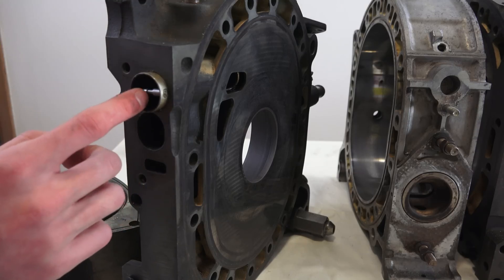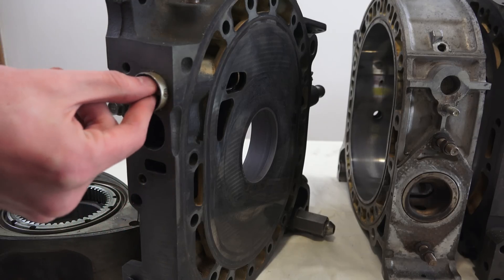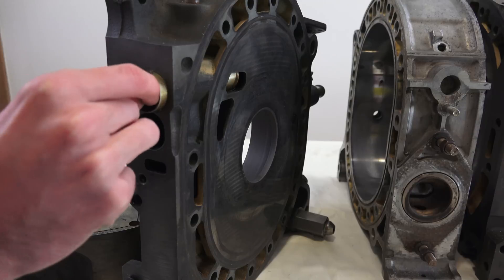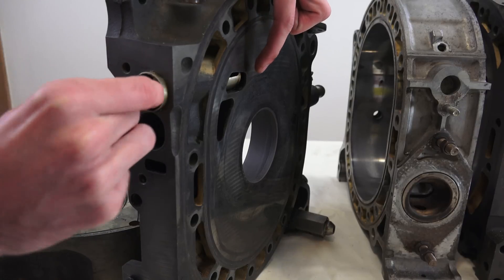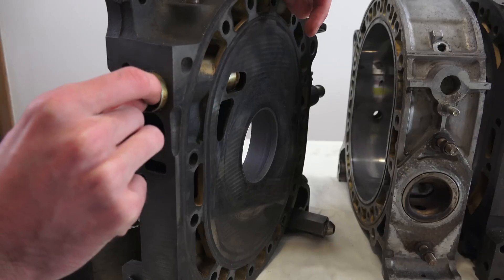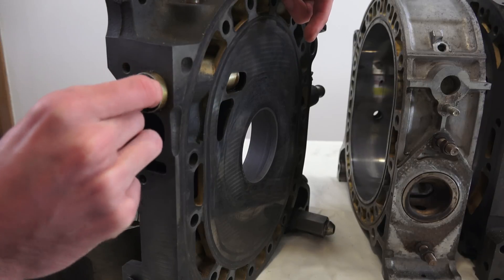Checking that out from the side, you can see there's a little latch on there. A solenoid will open and close to actuate this, opening it up to allow for more airflow or reducing airflow to increase air velocity and maximize the air-fuel mixture mixing process.